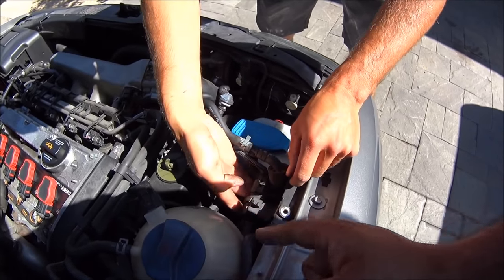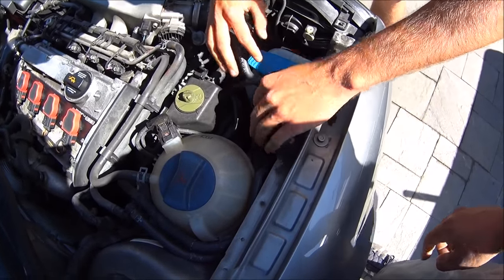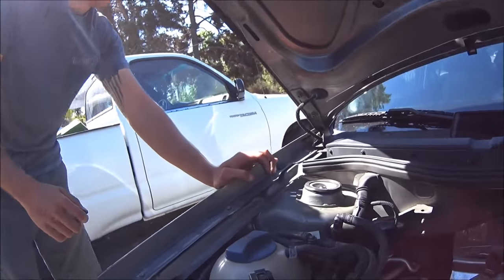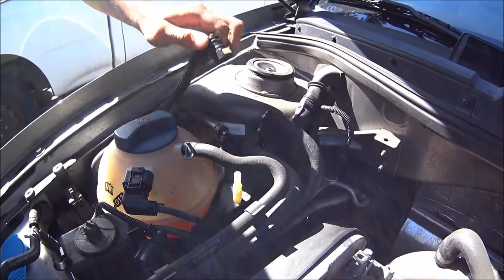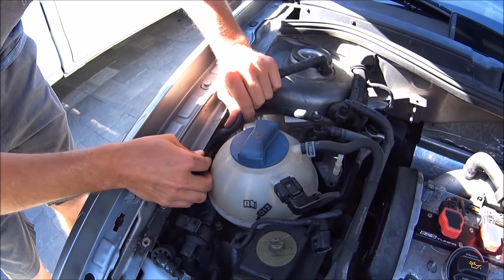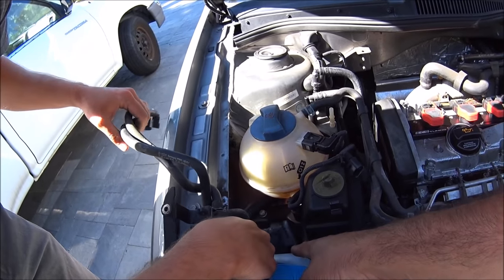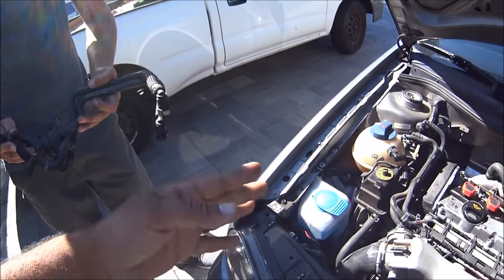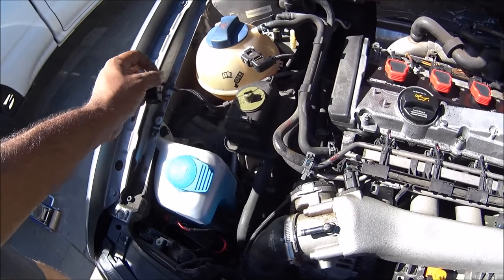There's a sensor definitely right here at the bottom — you're going to pull it back and then pull the sensor out. Follow the lines here and you're going to have these pinch-style tubes. Pinch it down here and pull straight up — it'll make like a big hiss sound because it has vacuum. Those two are out — now yank them out of the way, they're just clipped in. Follow the line and see what else it's attached to. There's another one right there — pinch and pull, and that's all of it. That's your whole entire smog system on the left side of the engine — that's out, you're done. There's a resistor that comes with the kit we ordered from Euro Tuning — that plugs right into this. Plug it in and dump it down there out of the way.